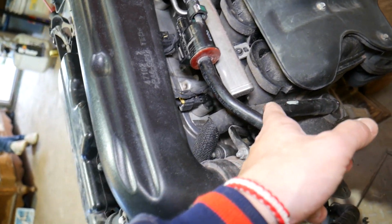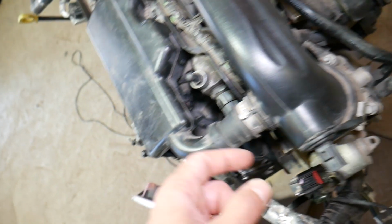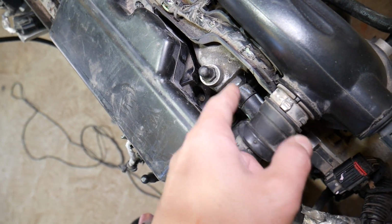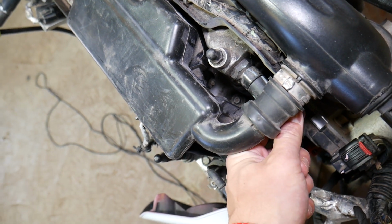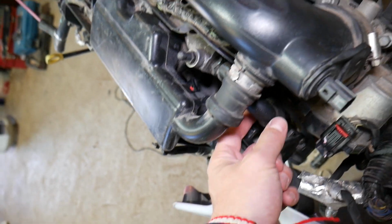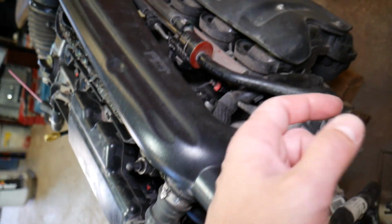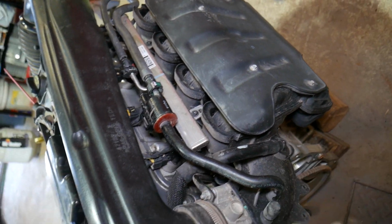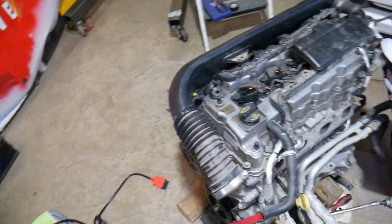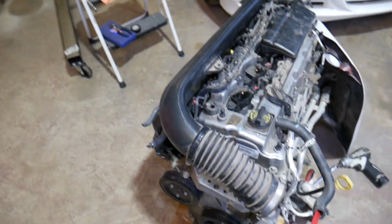This is the PCV line here as well, guys. The PCV hose. Make sure the PCV valve is working correctly. We have a video on how to test it. It can trigger that code as well, because it will simulate a vacuum leak. Make sure the hose is plugged and not broken somewhere, guys, cracked, and make sure it's plugged here as well. That's a very common thing. We have a special video that talks more about vacuum leaks and how to find vacuum leaks as well, guys.